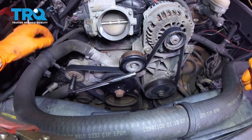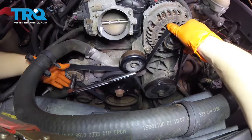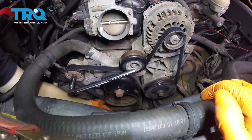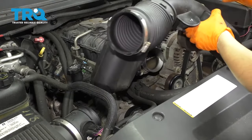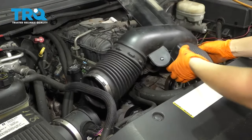Once it's on all the pulleys, let go. Make sure you put tension on it and then feel it — make sure it does not sit off of any ribs. I can see the crank is perfect also. Take off your tool.